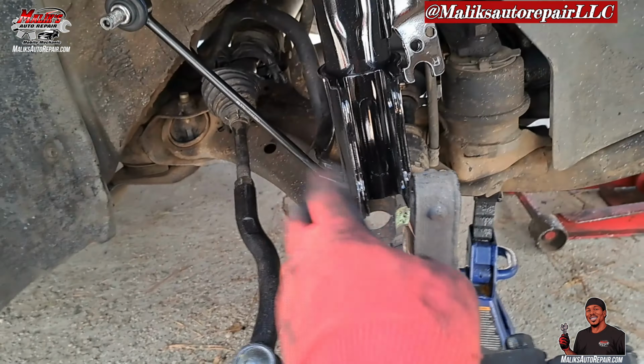All right, push that piston back. Make room for those new pads. Lubricate your guide pins. These are your guide pins. That one there, and that one there. Guide pins. Like that. All right, I'm gonna go ahead and jump on the driver's side, knock that out, fly through it.